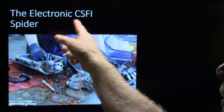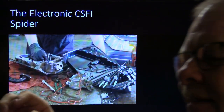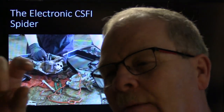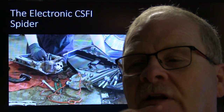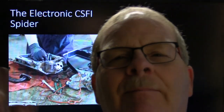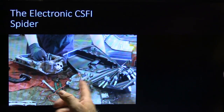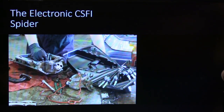This electronic sequential central sequential fuel injection system — you might remember how the original setup had the poppets with little solenoids up in the body at the top. Those solenoids basically gave you sequential fuel injection, delivering fuel pulses to those poppets. The wacky thing about those: if you didn't have over 60 pounds of pressure, it may not even start — you could have 56 pounds of pressure and that motor wouldn't start because the poppets wouldn't work. But even at the Chevrolet place now, whenever they work on one of these little CSFI systems, they take that old poppet spider out and replace it with an electronic spider that does exactly the same job, only better.